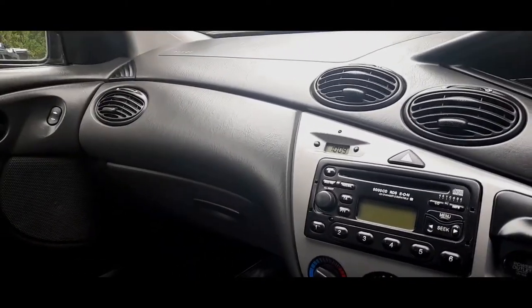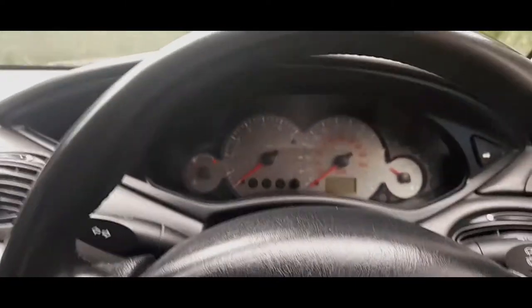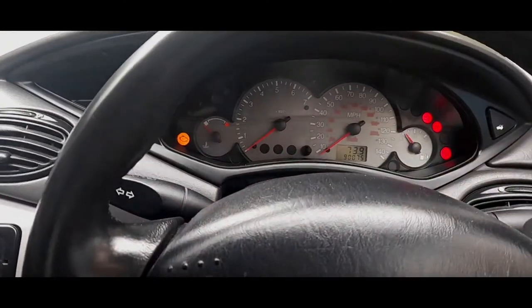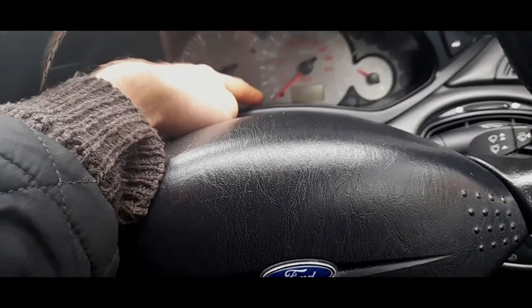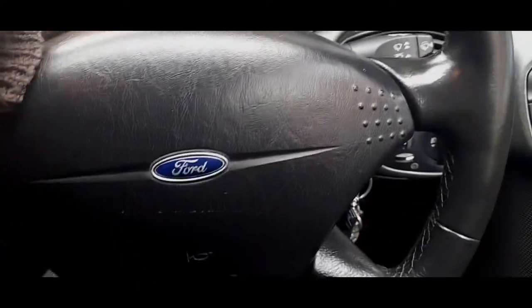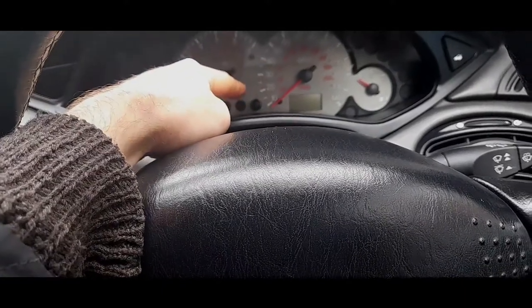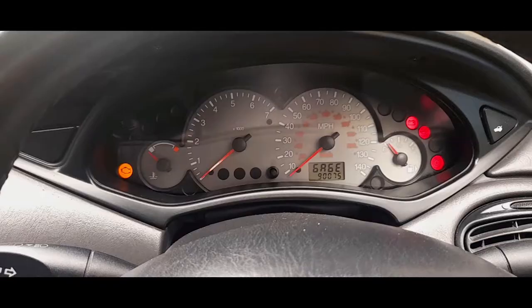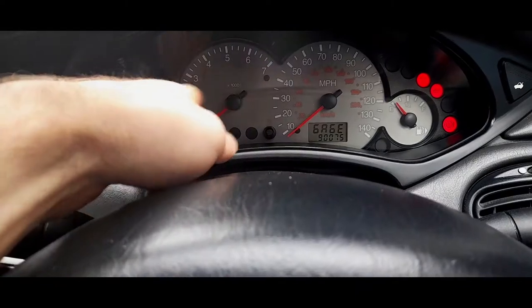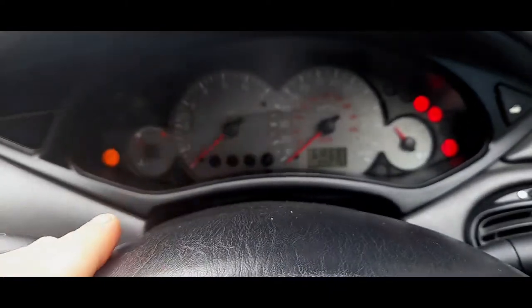What I'm going to show you is called the secret menu — you may not be aware of it. It's activated by pushing the pointer for about five seconds or so, then you turn the ignition on and it should say 'test.' All the dials will do a sweep and you're in the test menu. I've just taken my finger off that pointer — it said 'test,' then the gauges do a sweep.